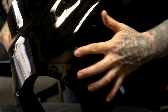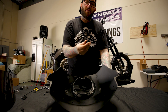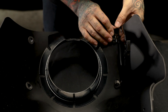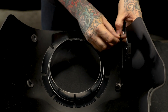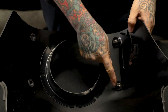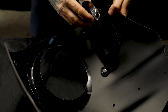With those popped in, hold them in place and flip it over. Now take your bracket — you can see that the bracket holes are slotted and the metal nut receivers also have a slotted area, so you want to line those up. Once aligned, go ahead and thread your bolt on. Leave them a little loose so you can adjust once it's on the bike. Make sure when putting the bracket on the fairing body that the tabs go in towards your headlight bucket, and make sure your quick disconnect is facing towards the bottom of the fairing. These will receive your clamps.